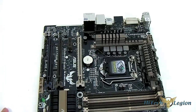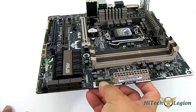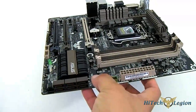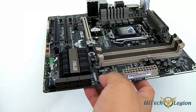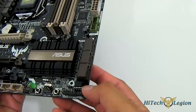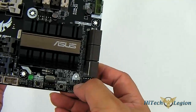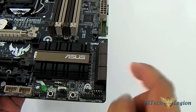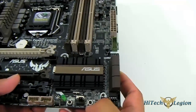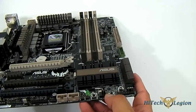You get the 24-pin power connector and a USB 3.0 19-pin header coming from the Z87 chipset, and 6 SATA ports that are also natively part of the Z87 chipset. You have a removable BIOS chip right there, and the front panel power I/O. This connector here is for the Direct Key — for those who are not aware, it essentially allows you to boot directly into UEFI.